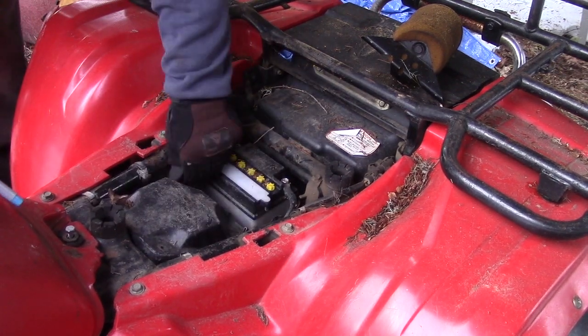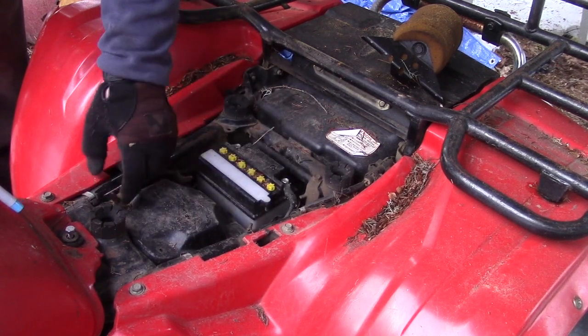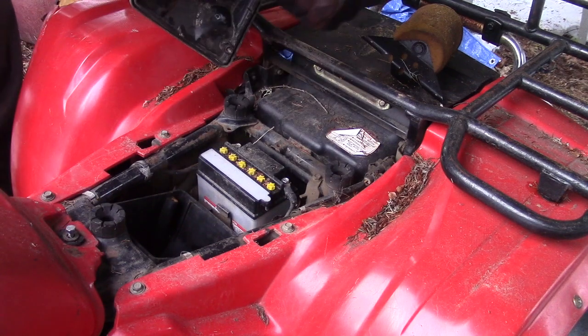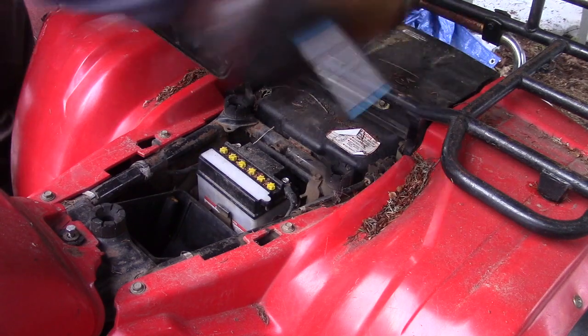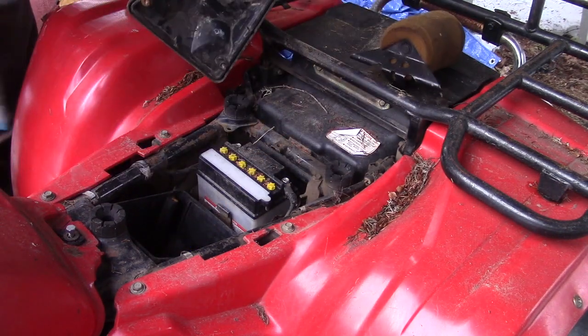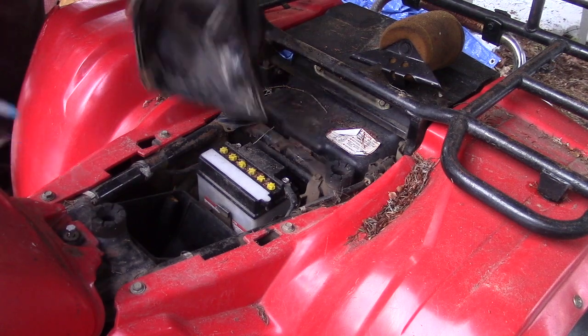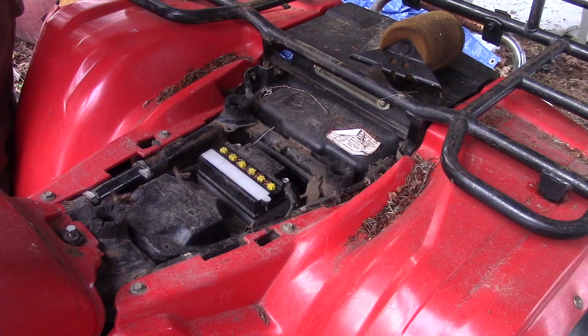Okay, some of the other ones are partially engaged, which is telling me that somebody's probably putting starter fluid or something down here to try to get it going. The air filter is sitting on the back, so that was taken out. Obviously, this air filter is no good and would need to be replaced. The air box is intact, no breaks down in there that I can see. Let's see if it'll turn the motor over. Actually, the battery sounds pretty good.